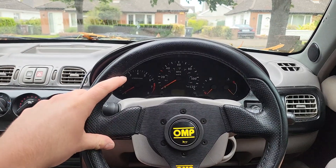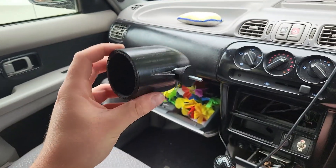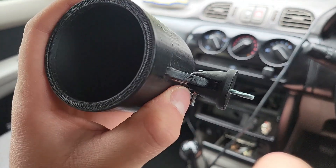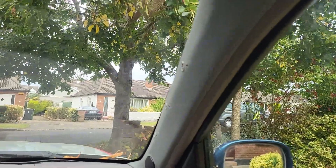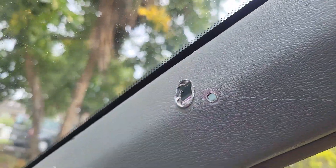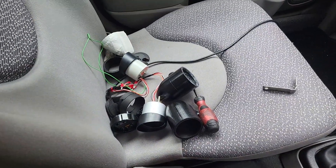The oil sensor is installed and all done. Lastly, these right here are the gauge pods I'll be using. I've made a few designs, prototyped a few things, and settled with this - nothing too fancy, fairly simple. Just a gauge pod with a little clip, two bolts so I can pivot and make adjustments. That goes in the A-pillar plastic trim here - I'll be able to adjust it to point toward the driver. I'll tidy up the holes; it's not going to be extremely neat but I'm not too picky. Let's go ahead and install these along with the gauges and finish it all up.